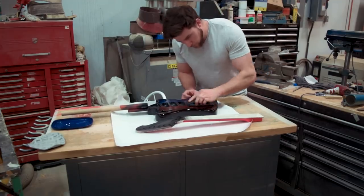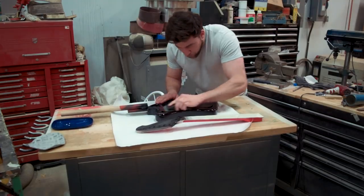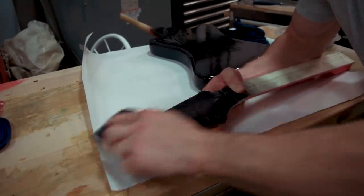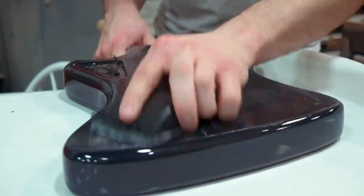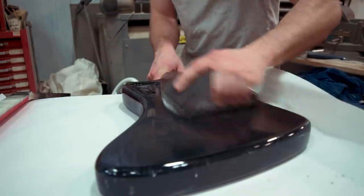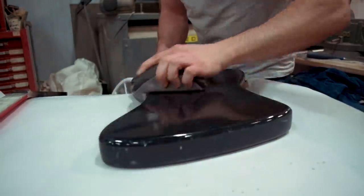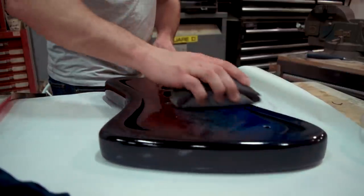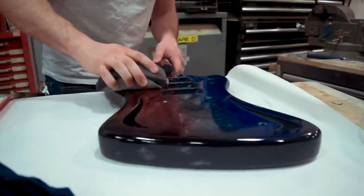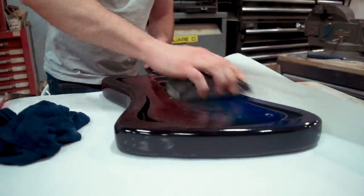So what I'm going to do is go through my polishing process here. I'm not going to explain that to too great an extent because I have a whole bunch of videos on how to do it. The gist of it is you sand your paint back level with something like a 1000 grit paper, then you move up in grits. I'm using a little bit of wax and grease remover to carefully lubricate this because I don't have the really high quality paper right now. With some of the nicer, newer papers you can just sand dry. That's what I'm doing here with these round pads — these are the higher quality papers. Essentially they're polishing this surface to basically a semi-gloss sheen because I'm going all the way up to 5,000 grit. I actually really love the finish that I get out of this just by buffing with a very high grit paper.